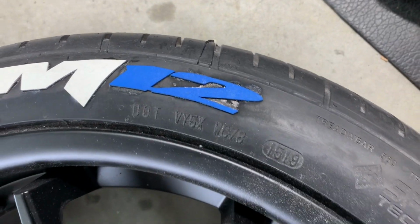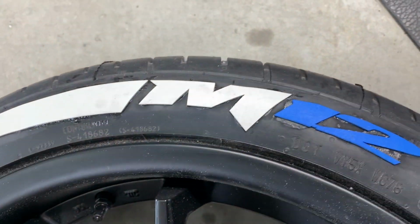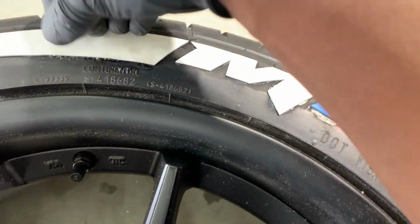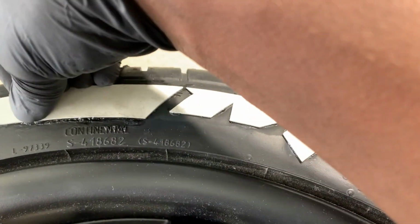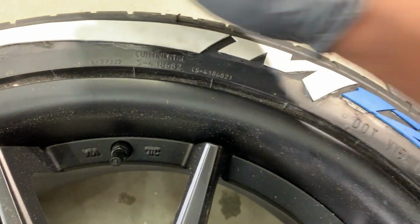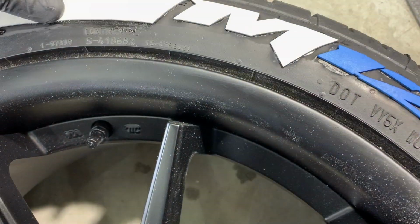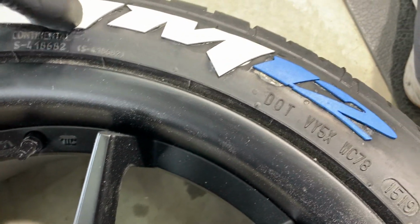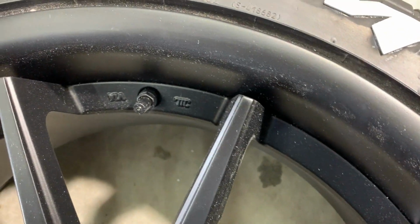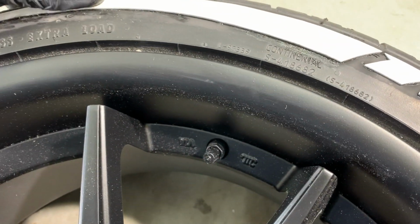Well, here she is. You can easily clean that out, but again, it's not even gonna show. So I'm just gonna push that down a little bit. See that glue's coming out. And you need about an hour. You gotta give it an hour to dry just by itself, right? So don't move, don't do all that crazy stuff. It is fast glue, but give it a chance. And it has to be about 65 degrees plus. So if you have a garage that's heated and you're doing this during the winter, minimum 65 degrees.